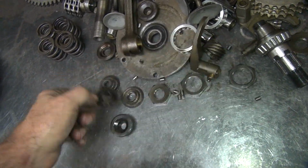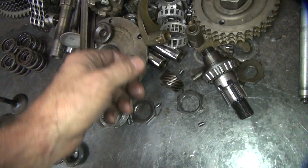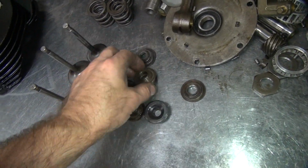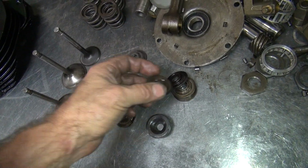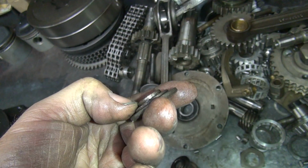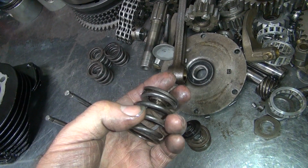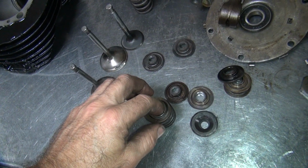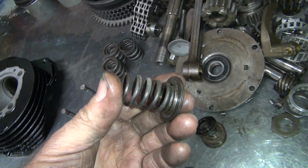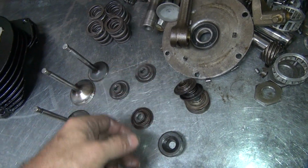Pull out the collars. The valves. Okay, these are stock lowers. So to put valve seals in the motor, you got to cut this lower collar off right here, flush. So you knock off that whole step. The steps center up the springs so they don't move around. The inner one's going to move around a little bit. Got some clearance in there. But we have to make room for the seal, so whatever can float around inside that spring is what it's going to do. Not the best situation, but it's all we got to work with to put seals in it.